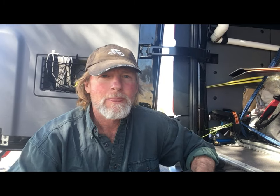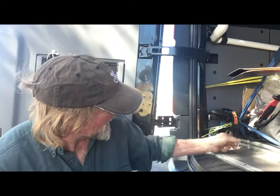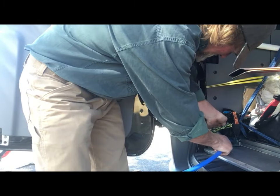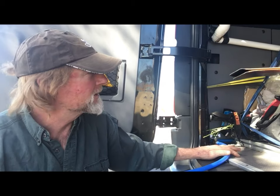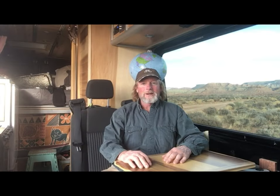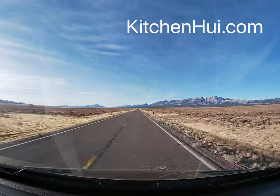I designed the van to drain relatively quickly and easily so I can go back and forth between summer and winter depending on what I'm doing. The water tank has a line that runs back to this back corner with a valve on it. When I want to drain it, I stick this on, it comes out the back, I open the valve, and it completely gravity drains the tank. That's it — that was the tour. I hope you enjoyed it. If you liked it, hit the like button, subscribe, and I'll have some videos on how I built this as well as where I took it. See you in the next one.